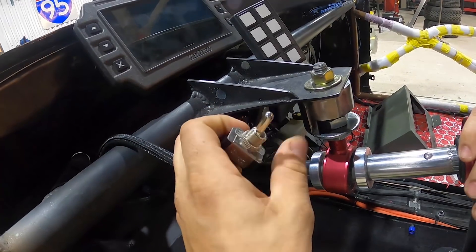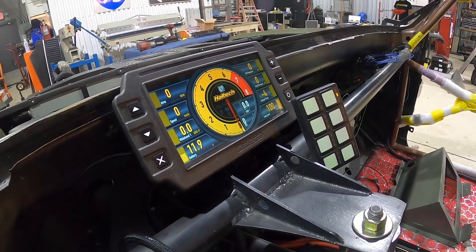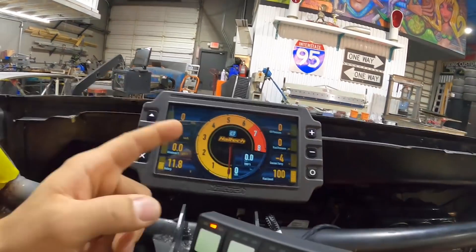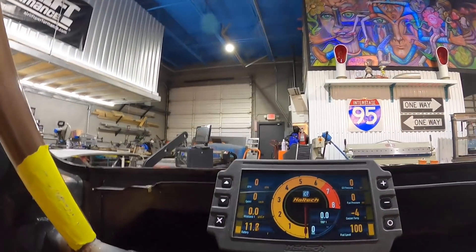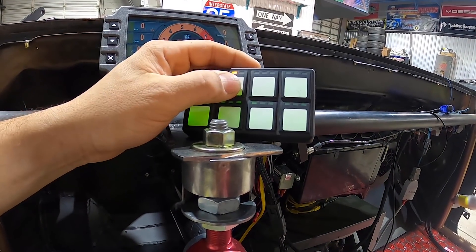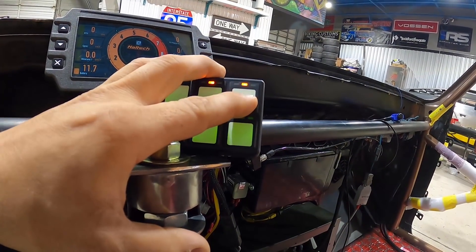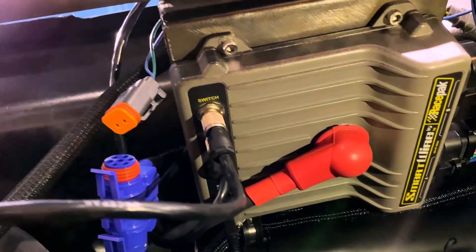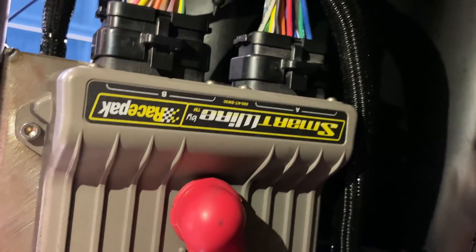This is our main kill switch for power — you can see the keypad came alive. This is our ignition button, which is going to give power to the inverters. We're going to be using CAN bus to stream data to the driver for gear position, speed, RPM, and all temperatures. With the programming inside the smart wire, we're going to be able to change different modes — two-wheel drive mode, four-wheel drive mode, gear selection, and an on button for each motor. The Tesla iBooster is all powered up via the Race Pack smart wire, connected to CAN bus, receiving data from the battery and the motors to do switching based on temperatures and motor mode positioning.